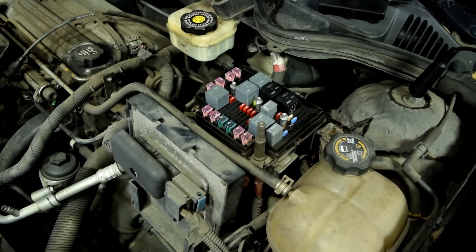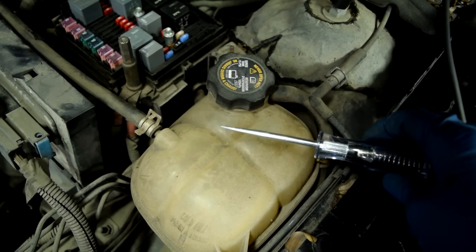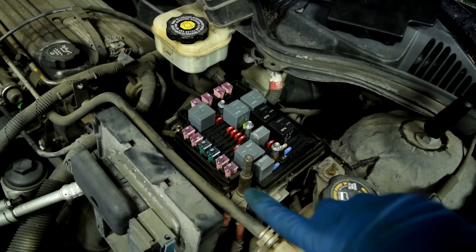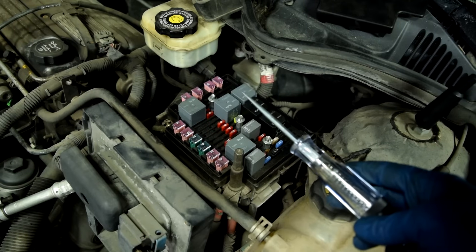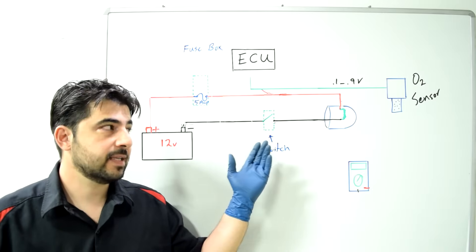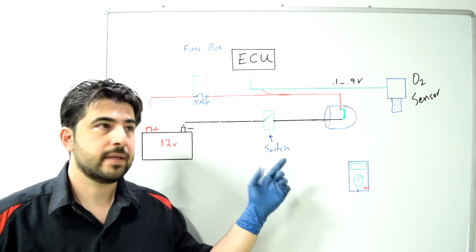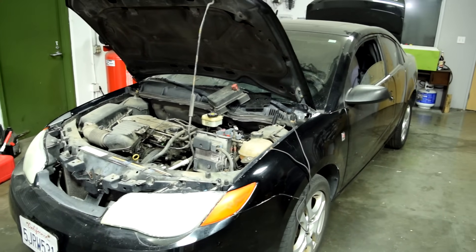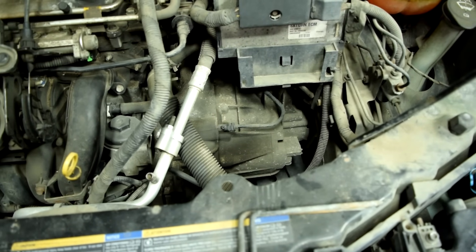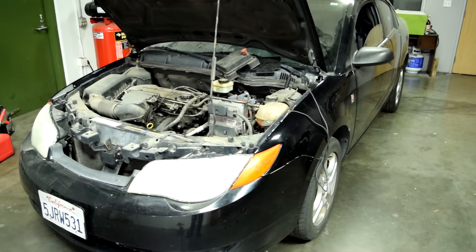As far as how you can find out to which circuit the signal wire on your O2 sensor is shorted to: first, make sure one end of your test light is connected to ground, and then with the other end on the pin for the connector attached to your ECU, you're going to have to start pulling fuses one by one. The one that makes the light on your test light go out is the circuit to which the signal wire of your sensor is shorted. Again, this doesn't happen that often — the majority of the time when you're talking about a short on a car, it's a positive short to ground that causes a fuse to blow, because the entire chassis of your car is grounded, and the same goes for your engine and your transmission. If any hot wire is worn out and comes into contact with any of them, it's immediately shorted out, causing a fuse to blow.